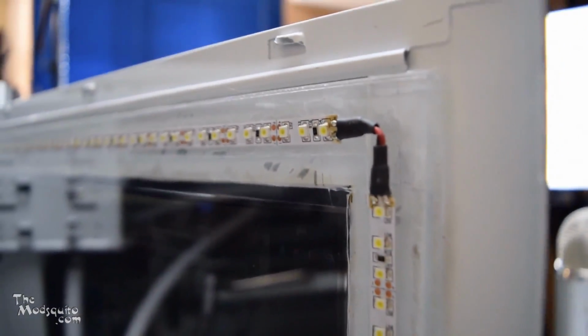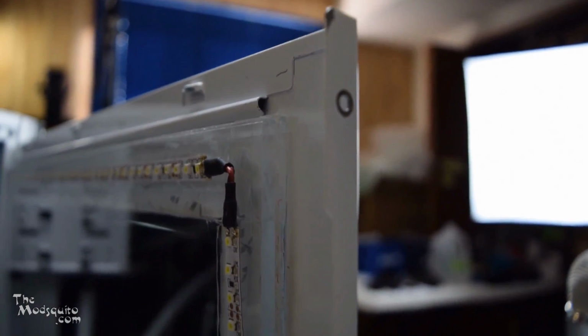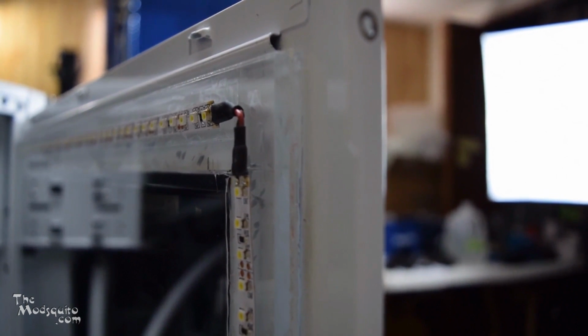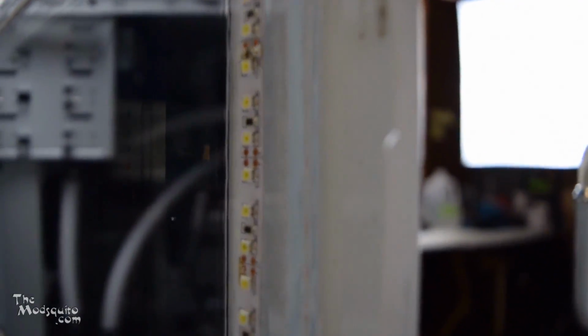So when I did this, I took two pieces of acrylic. I have 1/4 inch acrylic on the inside, 1/16 inch acrylic on the outside here. So that's basically all I did to mount the LCD panel in there. And I took Modder's tape of the gods, MMPC Tech, go look that up. I can't remember, 4010 tape maybe, 3M, Scotch, same thing. Anyway, that's what I assembled this with. So in between those two panels, there's some tape, and there's two layers of it, and that's what I used to effectively sandwich the panel in there.